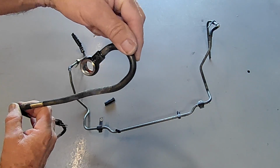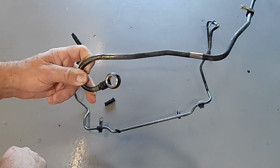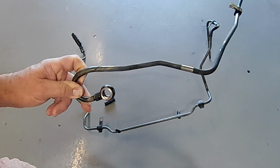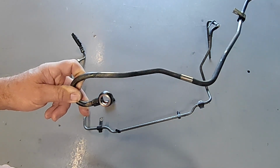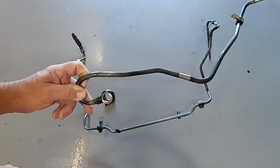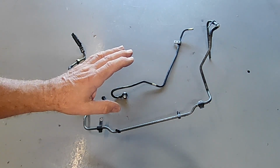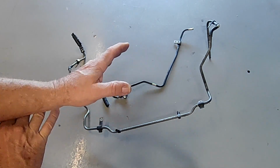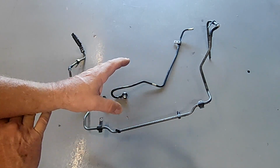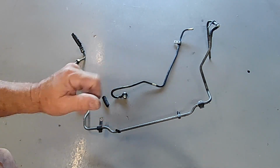I could have actually used that. It would have been a pretty perfect size, but I want to try and get rid of all the hose clamps and rubber hoses and stuff I can on the vehicle, just to alleviate all the issues with oil leaks that these things have because of all of this kind of needless crap that's on the car. So anything that I can, I'm using AN fittings on, and PTFE hose, just because once it's done, it's done. There's no leaks, it's all good. So I'll take you up to the car and we'll have a bit of a look at what I've started.